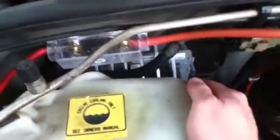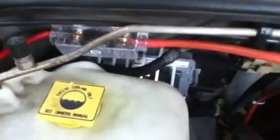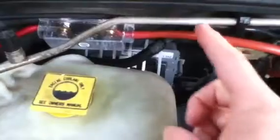Now, what dyingjeep.com tells you to do is disconnect the battery terminal, like I said, move this out of the way, undo your plugs, take your ECM out, and then there's 2 screws, not on all of them, but on certain years. There's one here and there's one on the left. You'll see it right underneath these plugs. Kind of hard to see. It's kind of right there. They tell you to put washers underneath it, and the reason being is that it will back off your screws that go into this computer, and they say that these screws short out your circuit board in here.